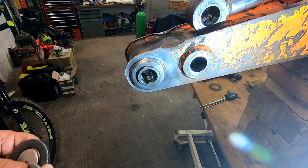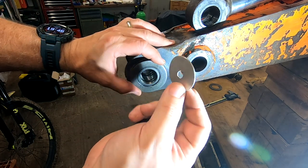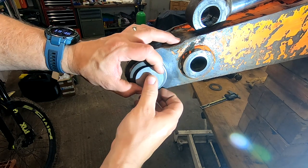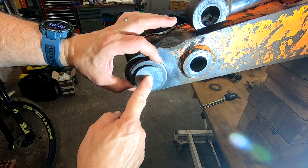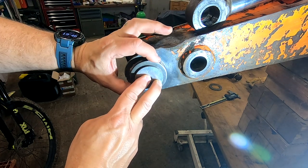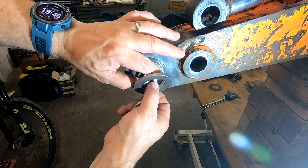We're all cleaned up. Now what I'm going to do, because we were fortunate when we cleaned it up, we've gained enough to give us some slack. So all I've done is I've got a bit of 1 mil shim. It's only a bit of alley I'll cut out, and then just a big washer over the top, and I'm going to put some studding all the way through. And as you can see, we've got a bit of slack there now. So I can do that up tight, and I can just space that out, and I can splurge weld all the way around. She's going to be a good one. And I can do the same on the other side as well. But I'll start on this side, and I'll set it all up, and hopefully we'll be ready to go.